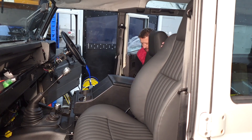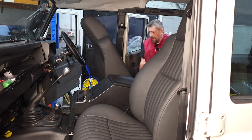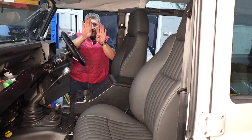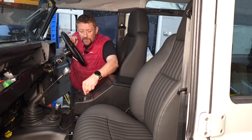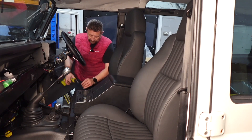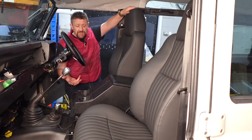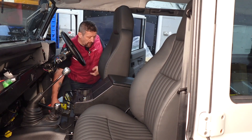Collapse the seat as if it's reclined forwards, open it up to the first latch, and just offer it into position like that. Out of the box, you might find your runners are slightly skew-whiff, either this way or that way — don't worry. Just loosen the bar at the front and get them so they match up. Once you've got your front two ready, you just want to drop them into place. Once you've got your front two bolts in place, you want to lift that bar at the front — it's exactly the same as a standard Defender seat. Lift it up, slide it forwards, and then you can get access to those bolts in the back.